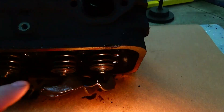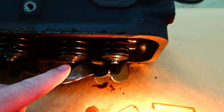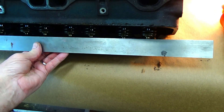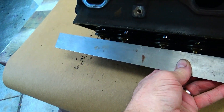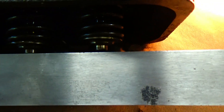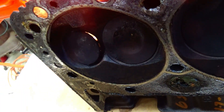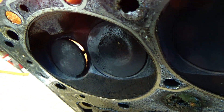You can also see on this side how the valve is down. If I put a straight edge on there, you can see - I'm putting it on the valve tops - and you can see that all of them are pretty much lining up and matching, except this one right here. All the others are equal along the length of the straight edge. So that's it - the exhaust valve appears to be stuck open.